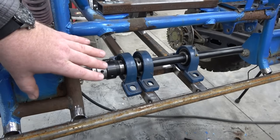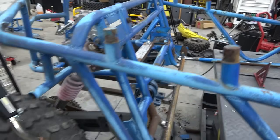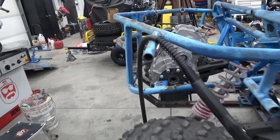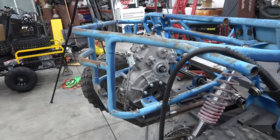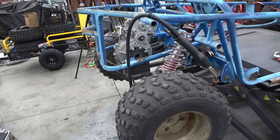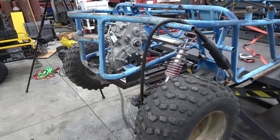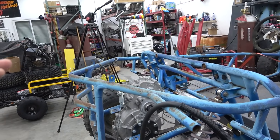I've got my gearing all figured out for all my sprockets, because we want to have a final drive ratio at the tire of 8:1. Now this gearbox is 13:1 stock. So we talked with EC Carburetors. They helped us figure up the sprockets because of this gearing ratio, and we know all of our sprockets. So we have to go get everything ordered, and then we can get the chain set up, and then we can start mounting the engine up here in the next video.